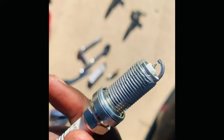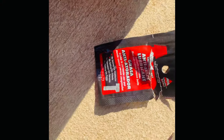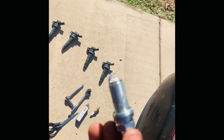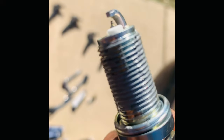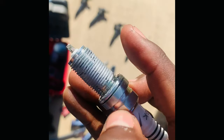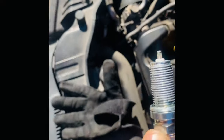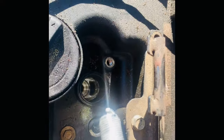Drop it on in and then reverse the process. What I did off camera, guys: I put this gray goo stuff on there — it's called anti-seize. Because the old spark plugs were a little rough getting out, and I didn't want to break an engine — that's the worst case. So I put this anti-seize on there, so next time these need to come out you're good to go. It's important to put it on the threads only — where you see these lines — and nowhere else. Then you just put it back in the engine and go about your business.